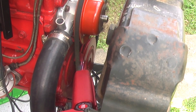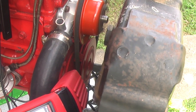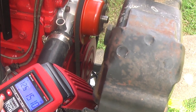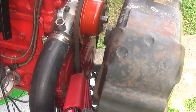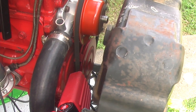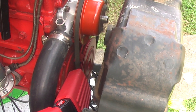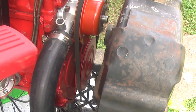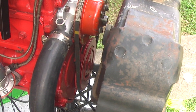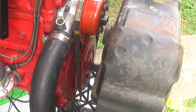It's starting really, really early now, I think. Let's take it up to about two grand. If you can see the numbers there — 18 degrees — that was at about 2,200 RPM. I've seen enough there. With this distributor idling differently to the last distributor that was in it, because the advance curve in this is starting too early. So we're going to have to adjust the primary spring and I'll show you how to do that.